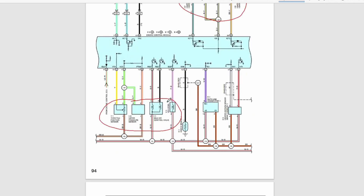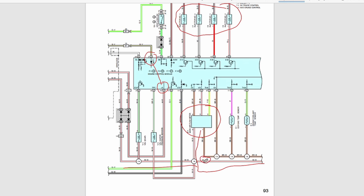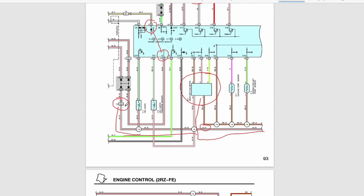Moving down to the idle air control valve and the VSV valve, you see a white and red power source wire coming down. The throttle position sensor and vapor pressure sensor both take power directly from the ECM, so ignore those. But the idle air control valve shares power with the data link connector, your oxygen sensors, and then gives power to your mass airflow and so on. Following this white and red wire, you'll see it also comes up to the 1K2 plug — meaning in the exact same plug powering your injectors and coils with a black and red wire, you'll also find a white and red wire powering all of your sensors.